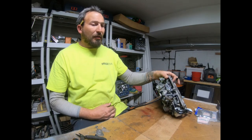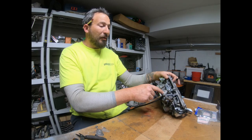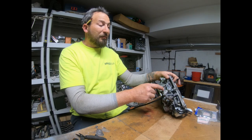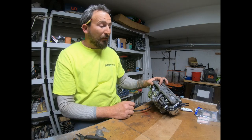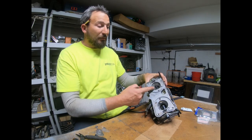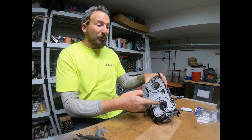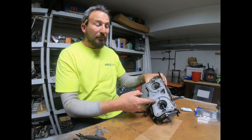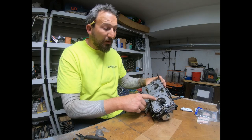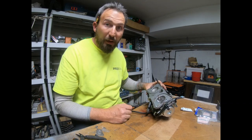This is the one out of my 2000. I suspect - see the accelerator pump right there - it's right off the throttle mechanism. I suspect this throttle pump is either bad or it's loaded up and it can't move. The reason I feel that is that you got these two jets in here, they shoot a blast of gas right in when you throttle, and none of that was happening. So I don't know if it's a total clog inside or what's going on, but I'm going to get to the bottom of it.